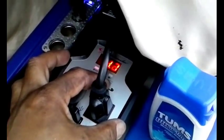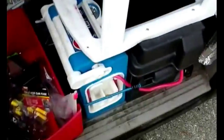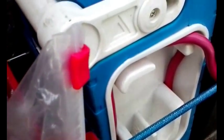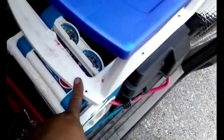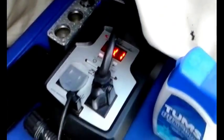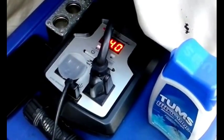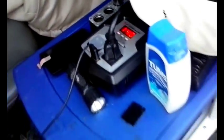The system is reading 14.1 volts, which is pretty good. My broken battery unit is charging but doesn't hold a charge — the battery inside is dead. I took it apart to get the part number but didn't write it down, so I'll need to open it again to order a replacement. The system is generating 14.0–14.1 volts, which is actually more than before — it used to read about 13.8, so the upgraded wiring has made a difference.